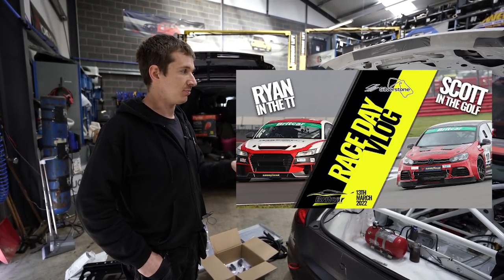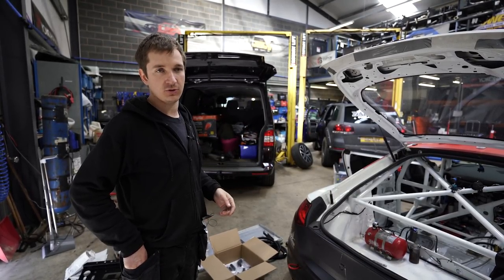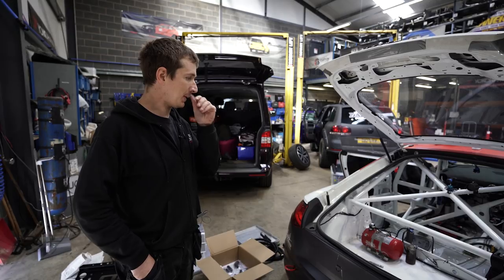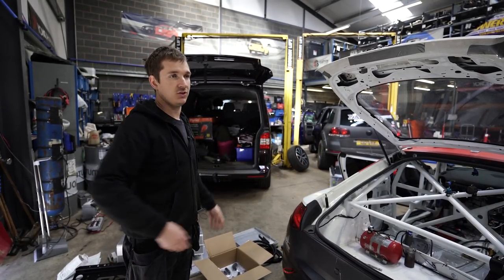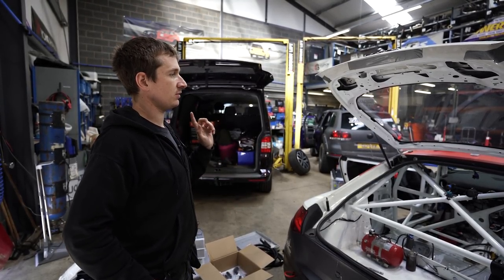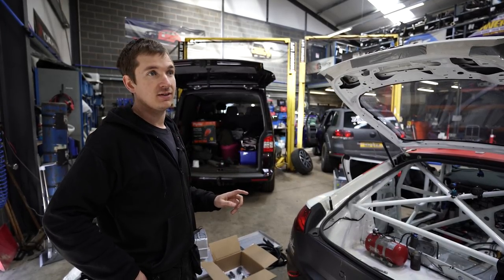surge, as did everybody with Mark 7 platform cars, all the guys that we were racing against. Even when they got like 25 and 30 litres of fuel in, which were down to just right-handers and the fuel all sloshing this way. But they had oversized tanks, so it wouldn't have hurt them as much as it hurt us. So we decided after that weekend we needed to get it sorted sooner rather than later.